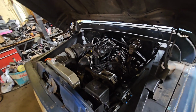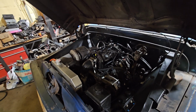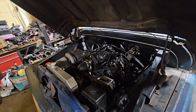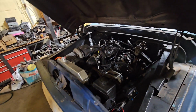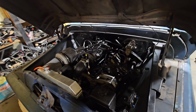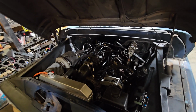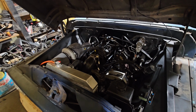Michael was telling me that he had a 347 cubic inch setup, and he had 80-pound injectors and a 450 pump and made 750 at the tires, and that was pretty much everything maxed out. So with the 535 and a 100-pound injector, hopefully we can crest the 800 mark and be okay there.